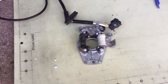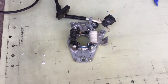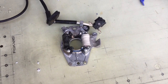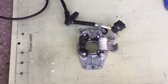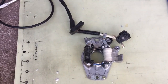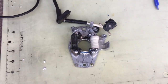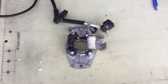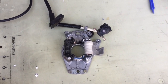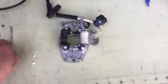I'd like to put it on and fire up the bike but I still have a bunch of other stuff to do. The last thing I want to say: I heard this mod is good for nitrous because increased cylinder pressure tries to blow out the spark. Hopefully this will give me a stronger spark at kicking speeds and also a stronger spark in general, which should help under high-compression situations when I'm running the spray. If you think this video is too long, feel free to make your own short video — I'd be happy to see other videos on this.